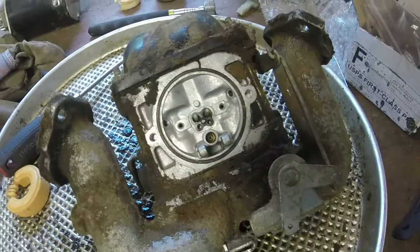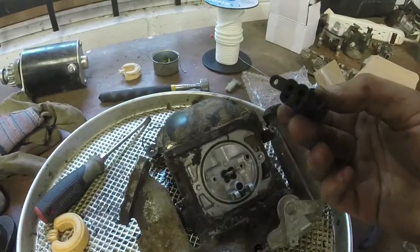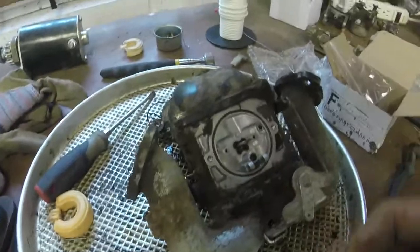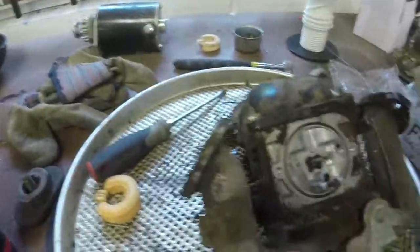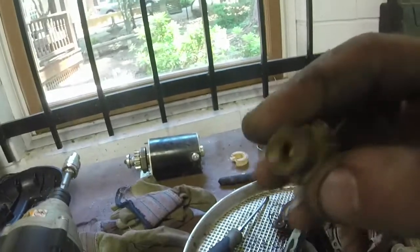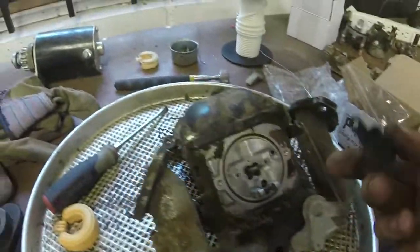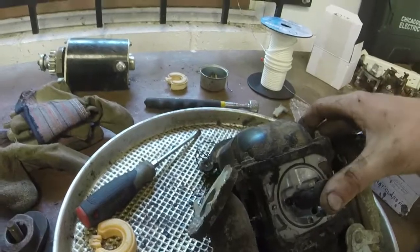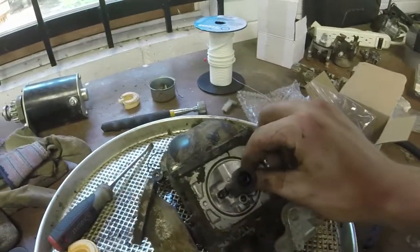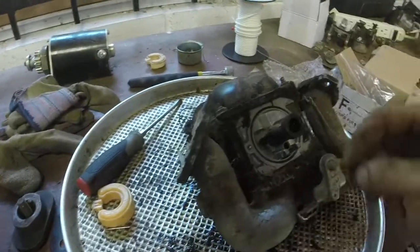Anyone who wants to educate me more is welcome to. I've got the main jet off — it looks like it goes down into the bowl like so. I've got two little jets that run up into each intake — those look clean. I think I just had a little debris in the main jet causing the issue. I don't see a low-side jet on this one like on a single-cylinder Briggs. I'm going to pop everything back together — put the needle, float, and bowl back on and slap it back on the mower.